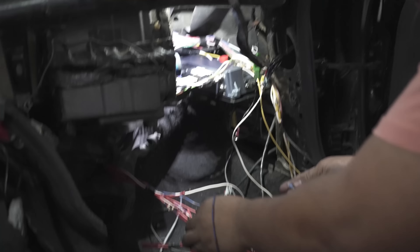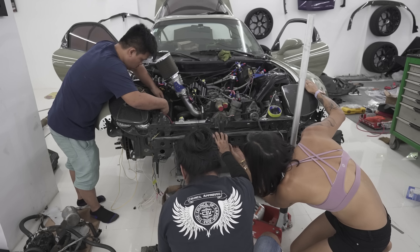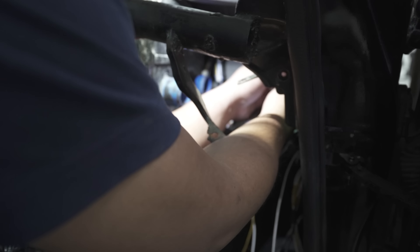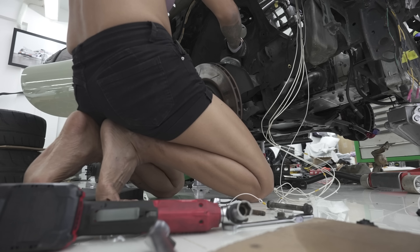Afternoon updates — we have the fuel pressure wire, the oil pressure wire, and the coil packs, which we're going to hard mount already. Norman and Mark have been busily working on the system making brackets. The igniters for the coil packs are now located behind the dashboard, hoping there's enough ventilation. They made a different mounting system for the PDM, and Mark actually used the Volkswagen fuse box — which we're going to convert to another wiring system anyway — to power the engine harness. I've also located a power bus bar system so the main power goes here and we can distribute positive power from this bus bar.